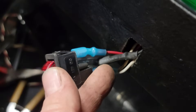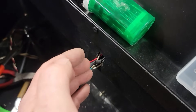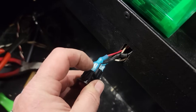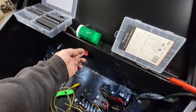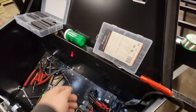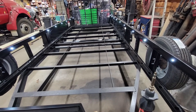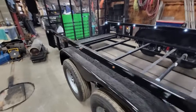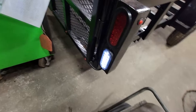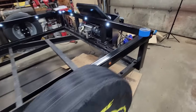I've got all my soldering done - you can see my diode right in there. I'm going to have to curve these wires a little bit since I don't have a ton of room back here and I don't want them rubbing. We've got four LEDs in this toolbox - that should be enough to light it up. With the switch on we have all those lights, our load lights, and we should have our backup lights as well.